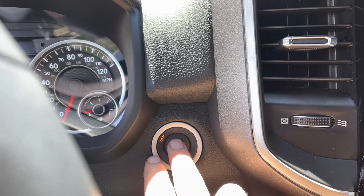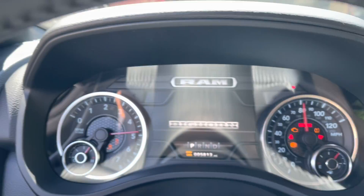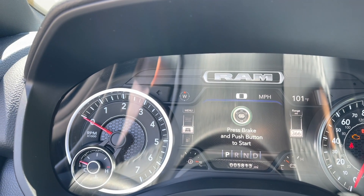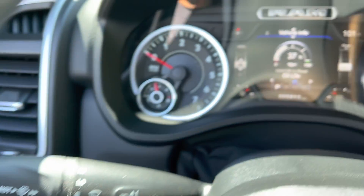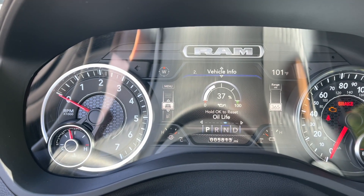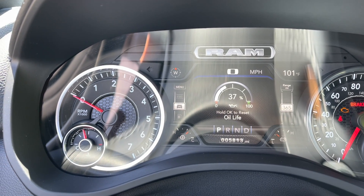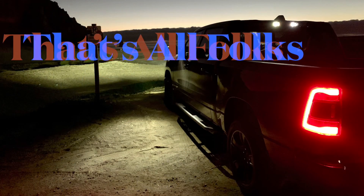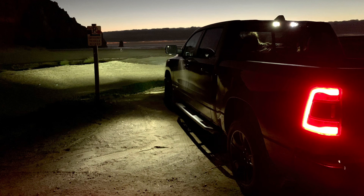Apparently you cannot reset the light with the truck started, so you have to shut it off. Then turn it back on, wait for the boot to happen, wait for it to clear, and then it'll let you get back there. You just want to hold the OK button and that'll reset your oil change life — you kind of have to hold it for a long time. Other than that, that's about it. Thanks for watching and I hope this video puts your expectations in the right place.